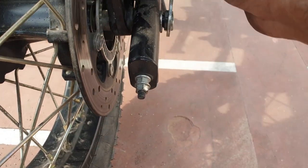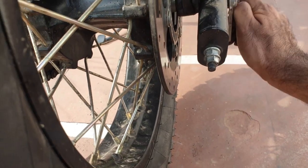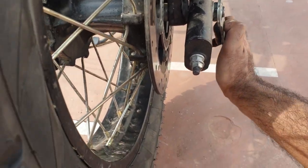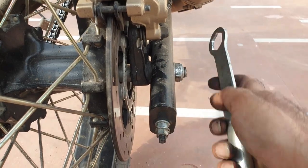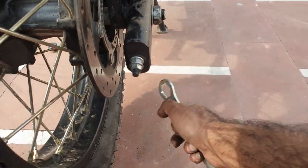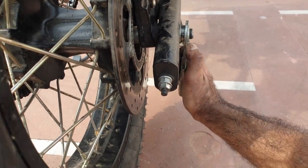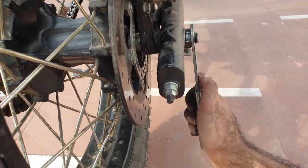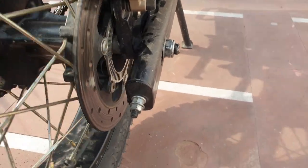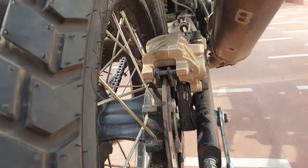Use these and tighten it. At the cost of repeating myself: don't tighten it too much — that can get a bit tricky and will take out your rear wheel bearings sooner. Mine are okay, I did check them. How much do I tighten them? Only enough to make sure that's not coming loose. Okay, perfect.